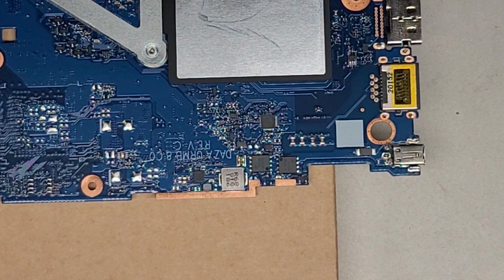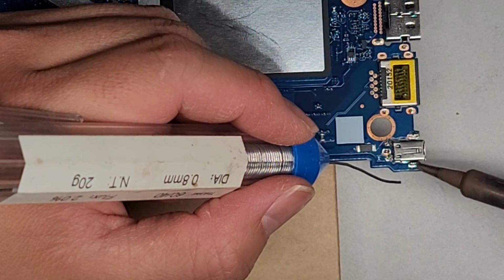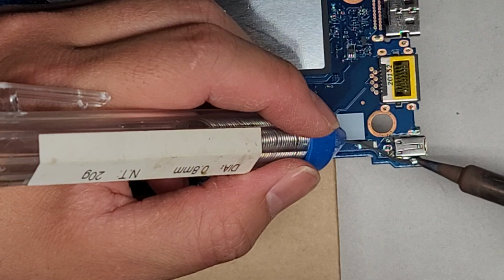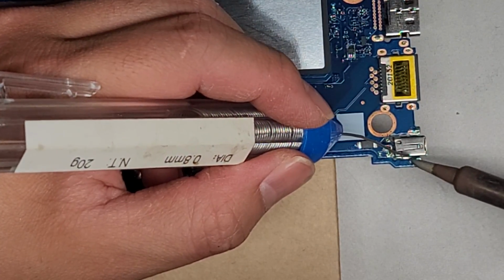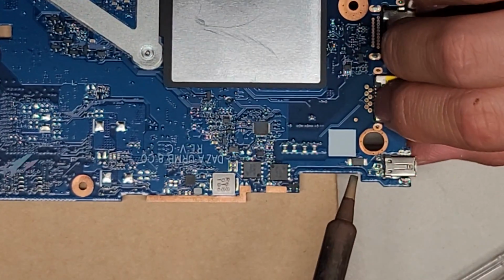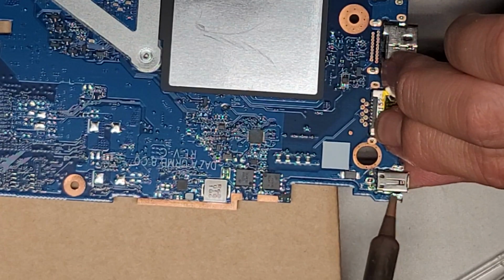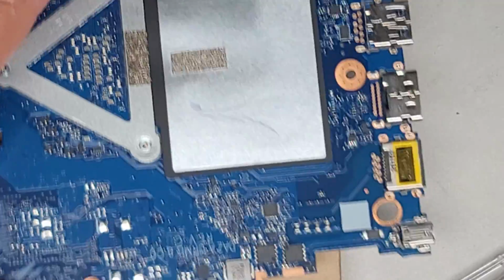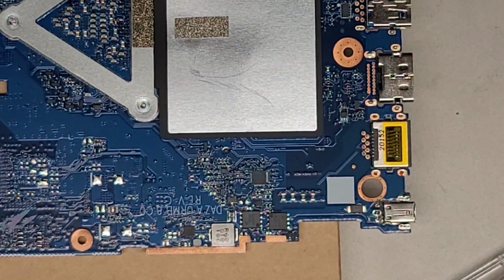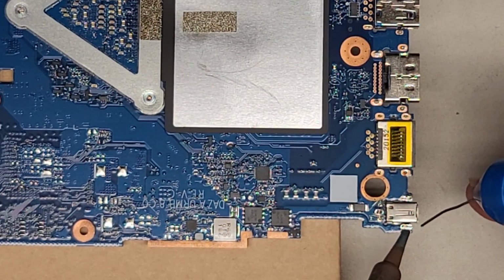It's a little difficult because it's kind of low. I need it higher, but I don't have another box that's bigger, so we're just going to try and do this. Put that up. There we go. Okay, and then once you've got that, I'm going to try and hold this and hopefully it won't burn me. Then we're just going to melt the whole thing together in there. It looks like all the solder flowed through to the other side, so we're going to have to put more. Heat this up some more and put some more solder in there.